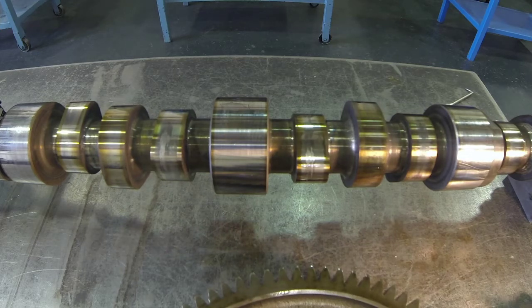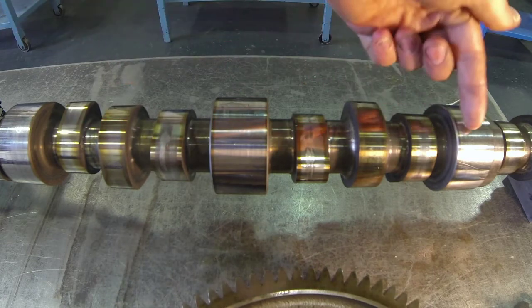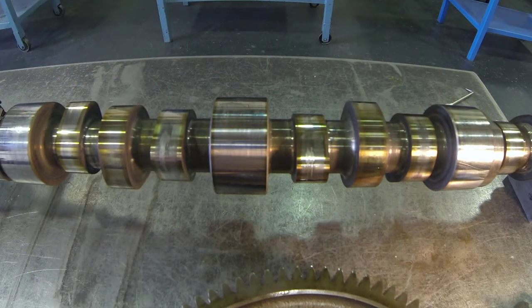When looking at the visual inspection of this camshaft from the ISX-15, we can see some discoloration on its surface. Some of this discoloration may simply be oxidization due to infrequent oil change intervals, acid exposure, moisture content in the oil from cold combustion not reaching operating temperature, or extended service intervals allowing etching to take place. Some discoloration may actually be from exposure to dirty oil.